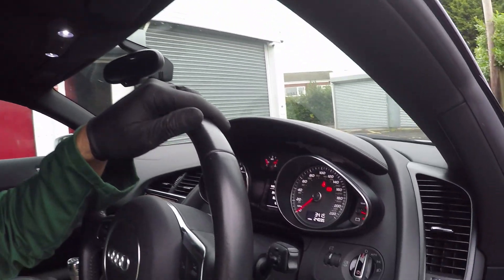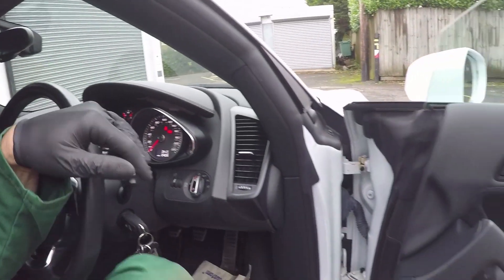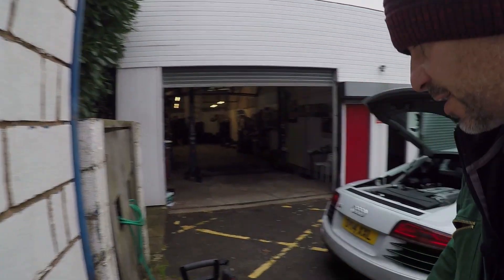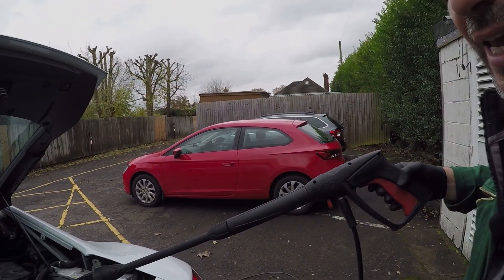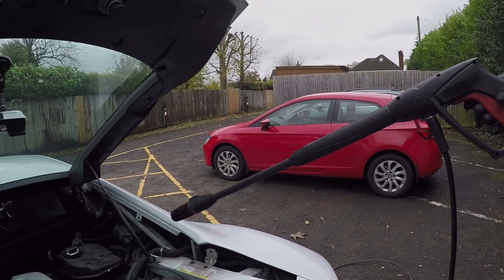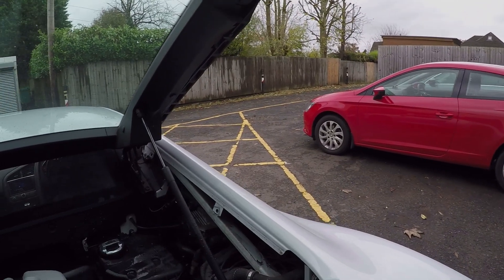I've quickly done the vacuuming around the hinges and I'm ready to get busy with the pressure washer. I also need to start the engine — I was taught that it's always best to run the engine if you're going to do pressure washing, because it keeps everything moving and stops water building up in areas where you don't want it. Let's just give it a quick test and see how sticky this dirt is — try the header tank. Yeah, not bad.